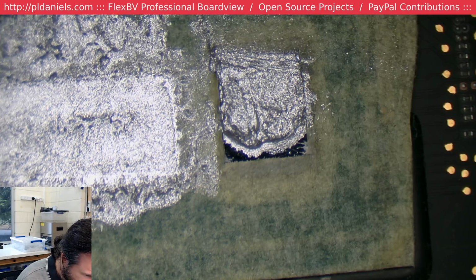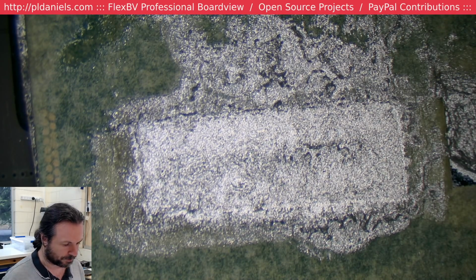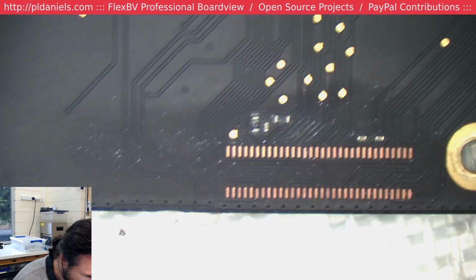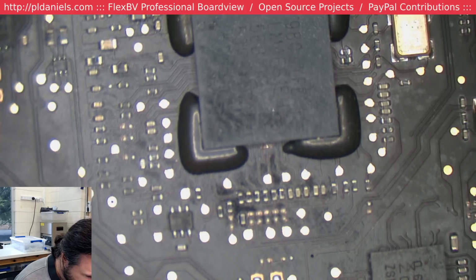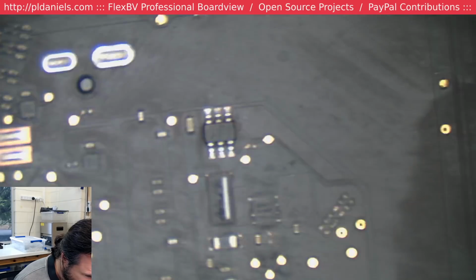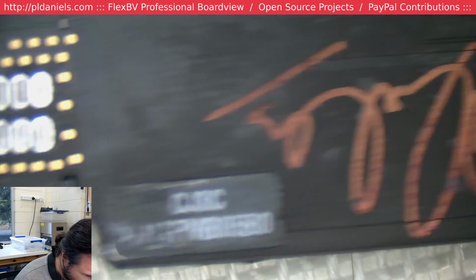What? And because they've got this tape, it looks like they've gone and maybe put Tesa tape down. It's just making it worse. So much worse. Have a look at the other side and see what else we can cry about, like little whiny techs. It's not fair, they touched the board before me. Yeah, I know, I'm mocking myself there. I'm allowed to do that. I'm trying to work out what this originally had as a problem. And honestly, I can't tell whether it was liquid damage or whether that's happened because of their judicious flux and lack of cleaning.